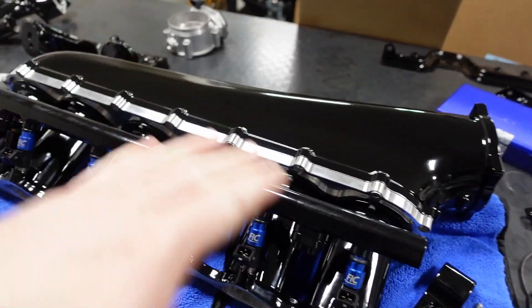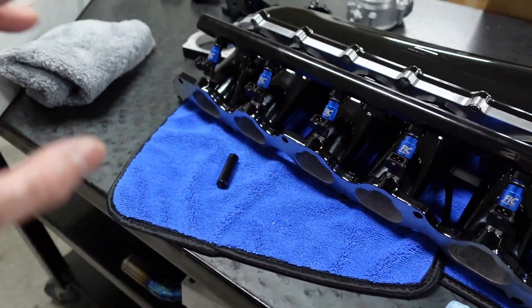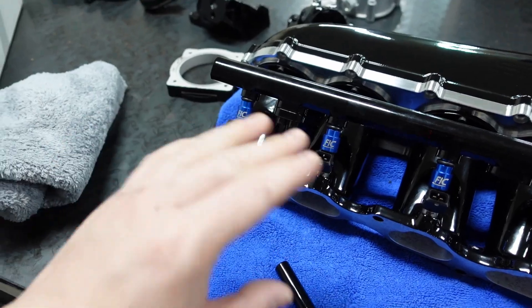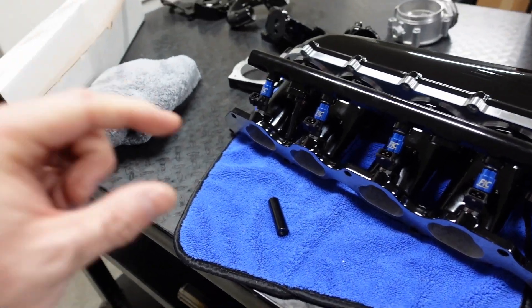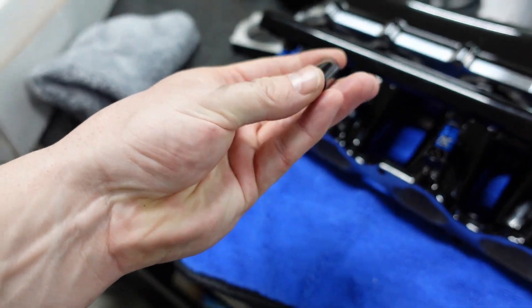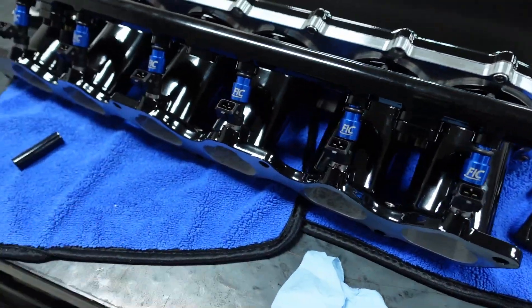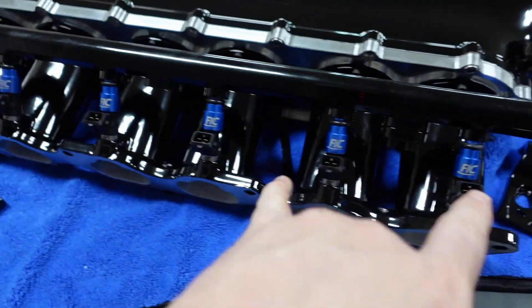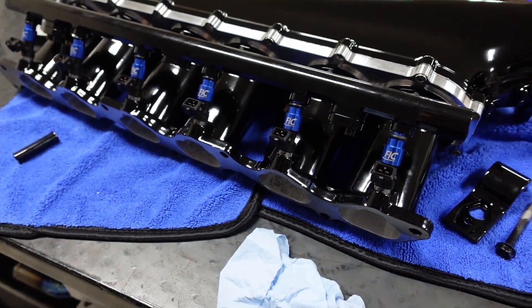I've been playing around with the intake manifold since it's all bolted together now — well, I put a few bolts in it to hold it together because it just looks cool. Put the fuel rail on, starting to put it together. I'm trying to figure out the bolt lengths because he lets you customize this, so I didn't get the lengths right before we powder coated. I might have to put the top and bottom on a sander to take some meat off and bring it down some. FIC were kind enough to sponsor me about three years ago and I don't take that for granted, so I want to keep the name on there — plus it does look cool.